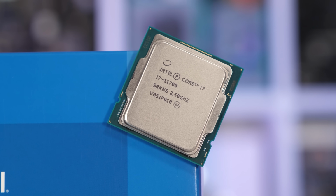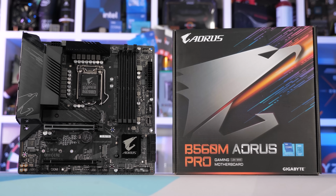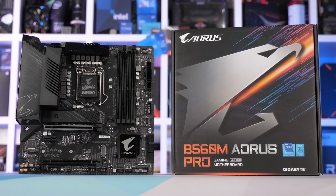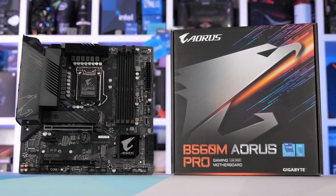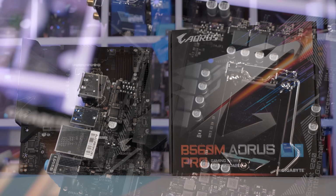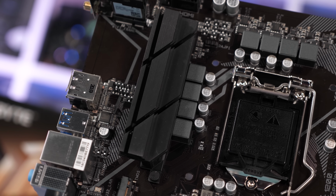So again, while it's true that the TDP limits don't really hurt gaming performance right now, it's unlikely to hold true forever, and that's important to note because without the power limits, the 11700 was just 4% slower than the 5800X in Hitman 2, but as the power limits started to creep in, it became 9% slower, and this is a mild example of what we're likely to see in more demanding games down the track.